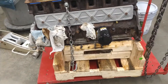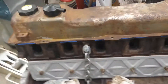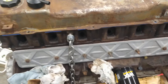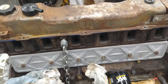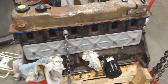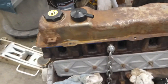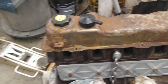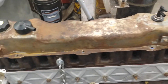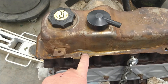That little trick works on the oil pan too. Now, this gasket for the valve cover — I picked one for an 86. A 92 has the cork gasket as well. This engine is out of an 86. But it works all the way back to 65 — I think you could probably use this on a valve cover all the way back to 65, so long as you get rid of the little nubs that are underneath each of the holes.